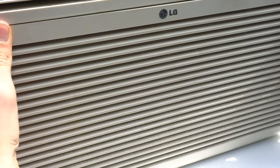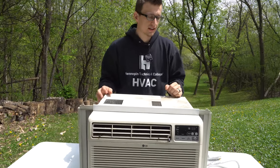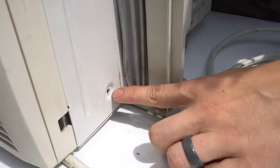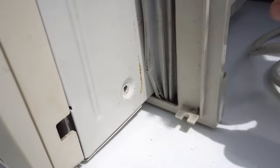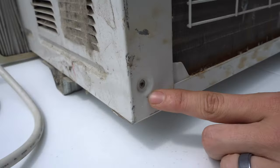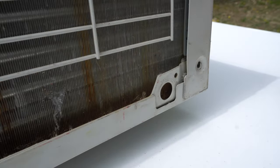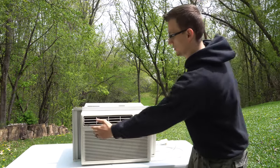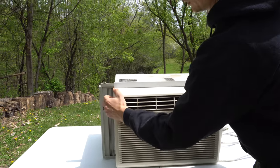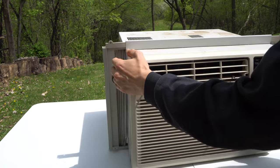So let's put that back and proceed with taking the casing off this air conditioner unit. In my case I just had to remove the screws — on this unit there were two in front, one on each side, and then two screws in the back which I already took out. After you've got the screws out, the next thing you want to do is take the front off. On mine it just has a couple of plastic clips on either side that you just pull on and it comes off.